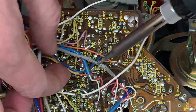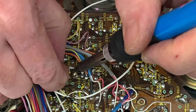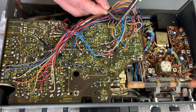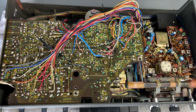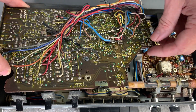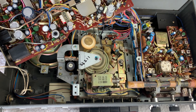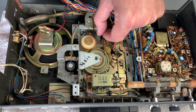You have to be a bit careful with this model because there are lots of cables all in very close proximity, so just make sure you don't burn through any of the others. We're nearly ready to remove the board now - there's just one capacitor to desolder. With the two white cables for the APSS light plus that capacitor desoldered, we can then gently lift and pull back on the board to clear the switches from the top plate and peel it back, giving us access to the belt.